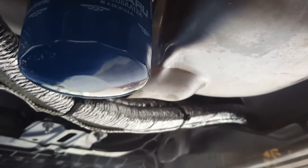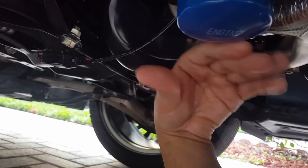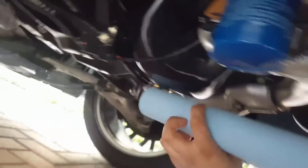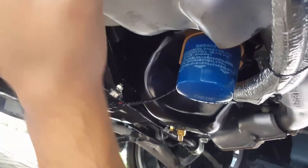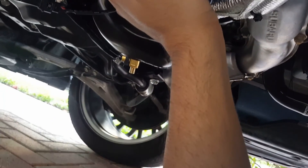I'll run the car like this for a day or so, make sure nothing is leaking. I'm happy that by adding this spacer, the filter didn't really extend too much further below than the oil pan — it's actually pretty much level with it. If you were to put a piece of wood here, it's pretty much level and not protruding below. That was one of my biggest concerns when trying to run this setup in the past. I haven't tested putting the cover on, but I may have to cut a small circle around here to account for the filter. I also know I need to cut a portion for these wires, so I'll be looking into doing that in the next few days.